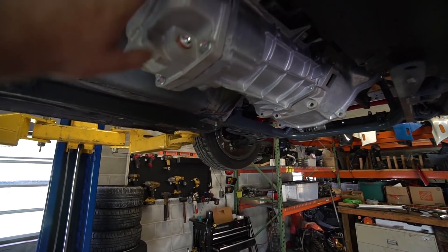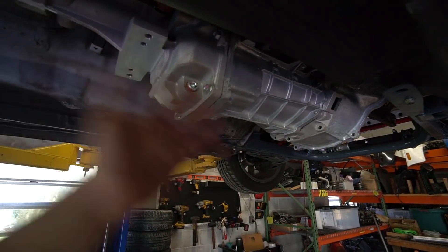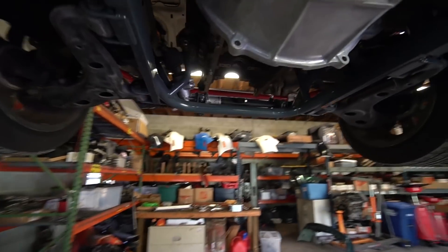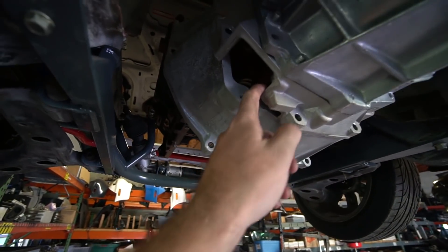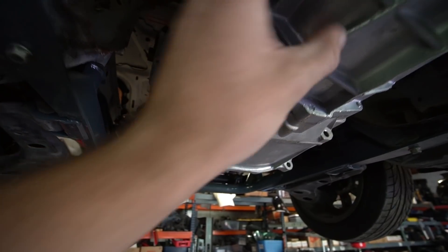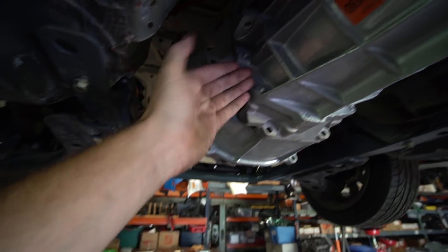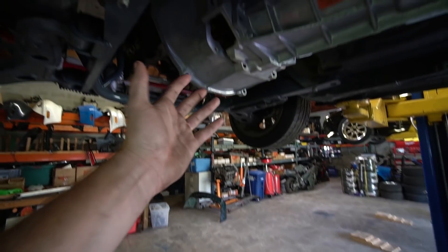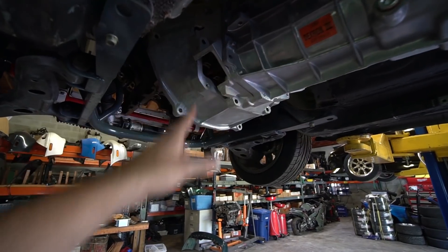This was the big dilemma — the thing we thought was trash. Looking at it in pictures, we thought it was definitely a rebuilt T56. Then I posted some pictures comparing the kits and we noticed this external slave cylinder bolt location and clutch fork position, which means this is an LT1 T56. The LT1 T56 came on the small block Chevy in Camaros before the LS came out. To adapt them to an LS, you've got to change the front plate, input shaft, and a bunch of stuff. So they just bolted on a T56 bell housing and none of this stuff is going to work as-is.